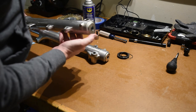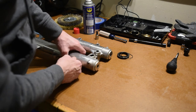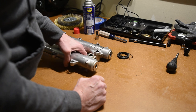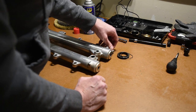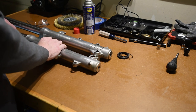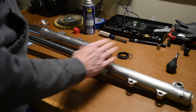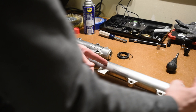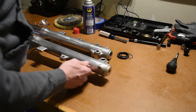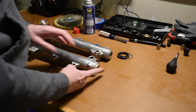Before you can take the inner tube out, you've got to get this bolt out, and this bolt is starting to strip. So that's a serious problem. The only thing I can think of is to just keep trying with the allen bolt until it strips, and then once it strips, I'll end up drilling it out. I'm just going to have to destroy the bolt in order to get the inner tube out. That's really the only recourse I have. And that bolt goes into a dampener rod in here — it's got a long steel rod that connects up here. There's no other option; that has to come out in order to get the seals out.